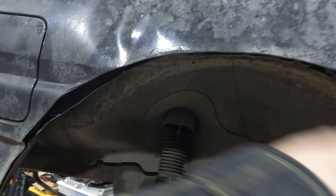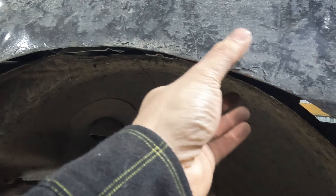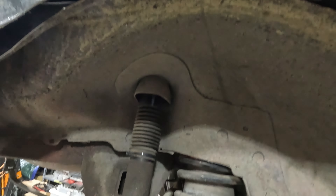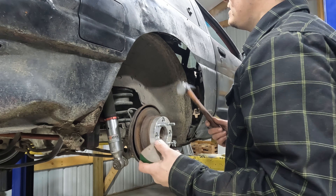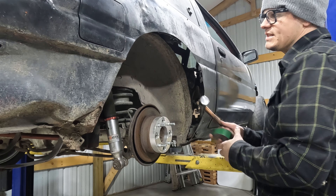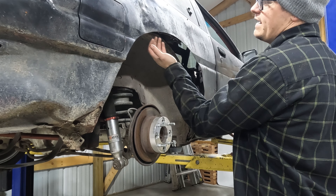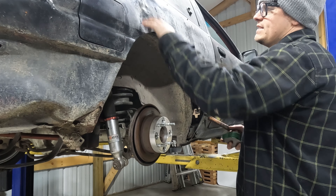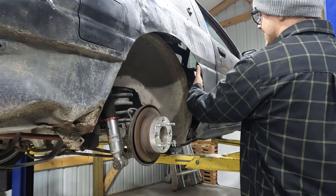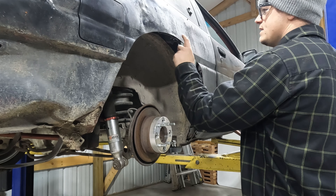You can literally just take pliers and pinch them together. I've seen people rivet them, which is crazy. Hammer and dolly — this helps a lot where this is all wonky and bent, you can just run this over it and kind of flatten it out a little. I can't do it here because I can't get access since this is cut too narrow, but maybe we can do the same thing from the inside. I'm just going to flatten this out so it looks nice and then give the outside a nice metal finish and get rid of some of the rust that's on here.